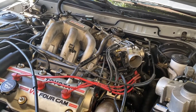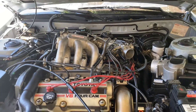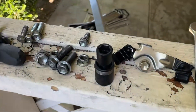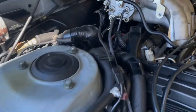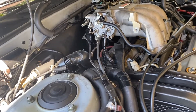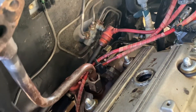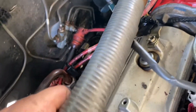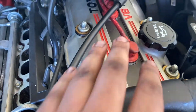The problem was just getting that free — it's the first few bolts with nuts as I showed you in the front, a mix of a few in the back. To get it completely taken off it's just these bolts, which isn't a lot, but some of them are just hard to get to. The hardest one to get to is probably the one on this side right there, just because I was hitting this. But it squishes in a little bit, so that's what ended up helping me clear it. So that's taken off completely. I loosened up the harness — you don't really have to take it off completely — took out the spark plug wires. I'm gonna get the spark plugs out and take the valve cover off, just need these six clear on each side, get everything out, and then put this one back together and do the front one.